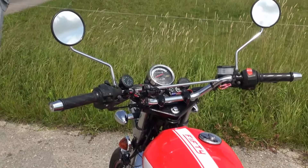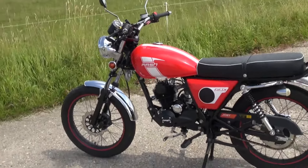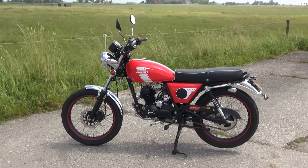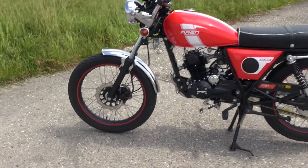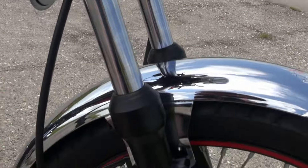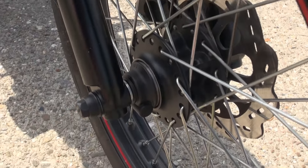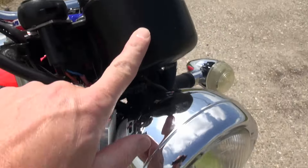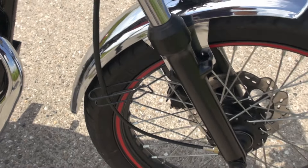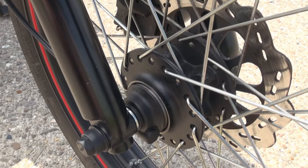I want to continue with the quality of the bike. I've always been very careful with maintenance and keeping it clean — I think it still looks pretty darn good for a five-year-old bike with about 25,000 kilometers on it. But there are some quality issues. The speedometer drive has been broken. I thought it was the speedometer cable so I ordered a new cable, but when I installed it the thing didn't do anything. So I took the speedometer drive out and that was broken due to pretty poor quality.